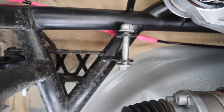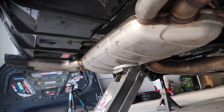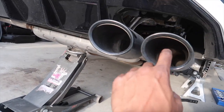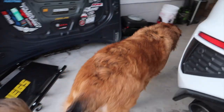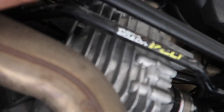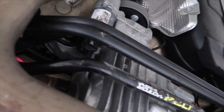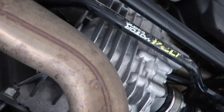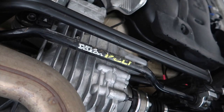The track bar mounts here and here after the exhaust. Your exhaust can just be lifted up like this — it pretty much balances itself. Wheels are on, everything's done, everything's tightened and double-checked. The track bar I thought went under the exhaust but it goes above it — I had to puzzle-piece it up in there to get it. That adds extra rigidity. The drag version of the subframe doesn't have a track bar — I have the track version.